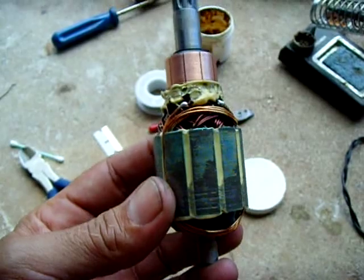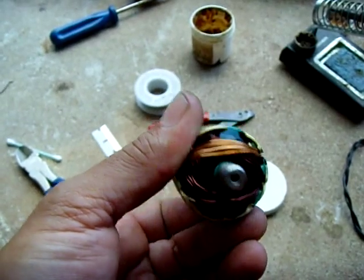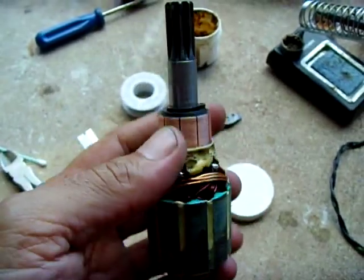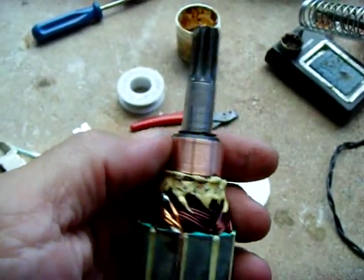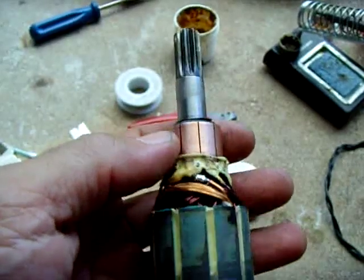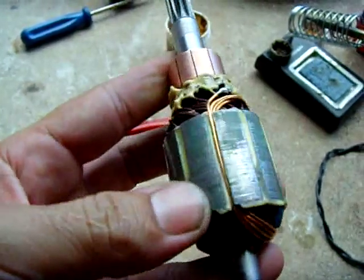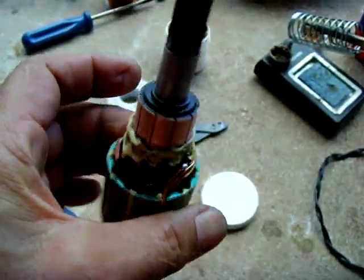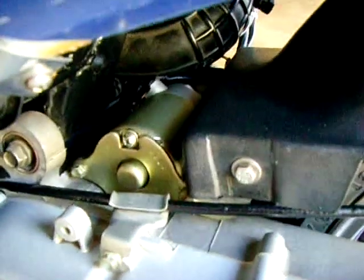This is the winding that has been replaced — you can see it goes all the way around, same gauge, 18 gauge, and I reconnected it. The armature is looking good. I cleaned the commutator, sanded that down. I'm going to put some JB Weld there and there to cover that, and also seal off these grooves with JB Weld, just like they did from the factory. Back in it goes with a new o-ring.